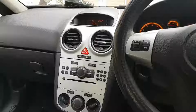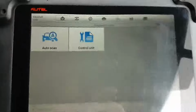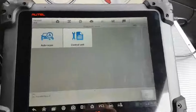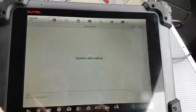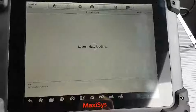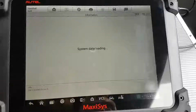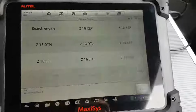If I don't have it resolved by the time this video is up, I don't have a clue what is wrong with it. So we're going to have to go back to our Maxi-Sys. One strange thing, well, not strange, is that it doesn't detect the VIN. Maxi-Sys takes the VIN from the engine ECU, and obviously it is not retrieving the VIN, which means to me we have this problem.